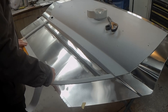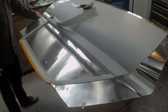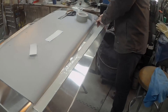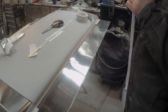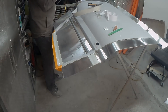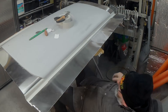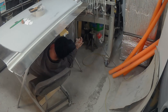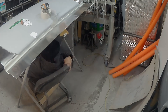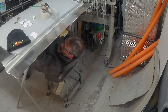The wood pieces will not behave properly unless they're primed, so a little bit of Duratec primer put on with a brush is fine — I'll sand it smooth when done. Then the aluminum foil tape goes on and you tape all the seams and edges where you've joined one piece of flashing to another. Along the bottom edge, the tape is too sticky and wide to fit in there, so I split it in half, bent it in half, and got it in. That roof edging is used on the bottom edge flange because you want it to return at roughly 90 degrees — that makes for a much better mold.